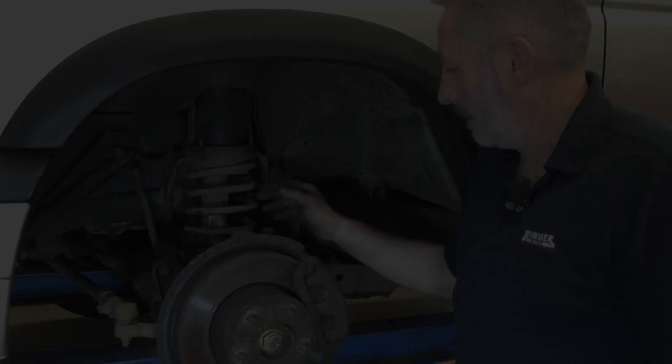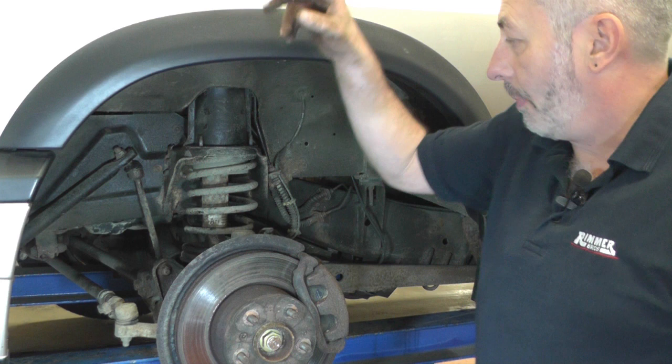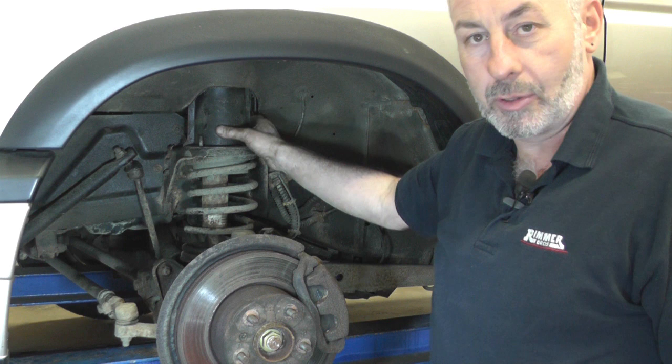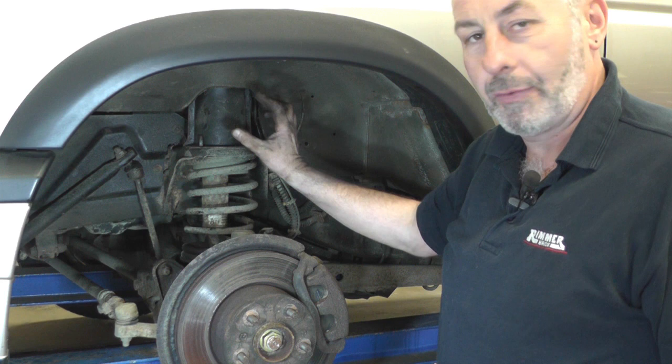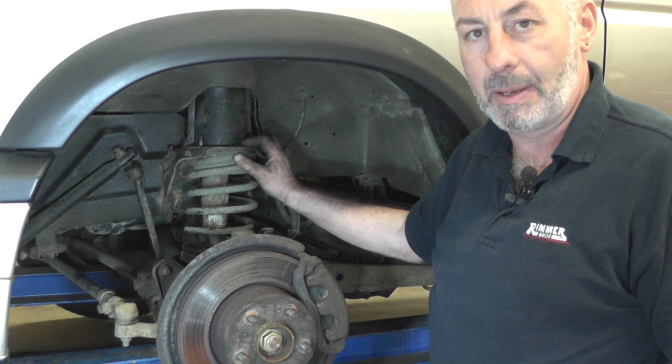So now I've got the two lower mounting bolts and the four turret nuts out. Underneath the bonnet you'll see the top of the turret — there's one main bolt that goes to the side of the shock absorber and the turret, so you take that bolt out. You'll also need to take off the boost pipe from the bottom of the turbo — you don't have to fully remove it, just move it out of the way as there's a little bit of a tight fit when lifting the turret out. Then I'll show you exactly what it all looks like in front of the camera.